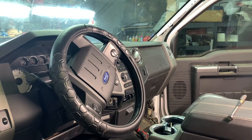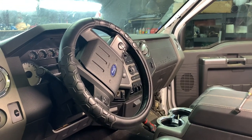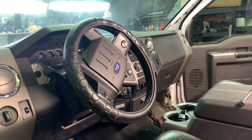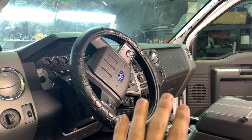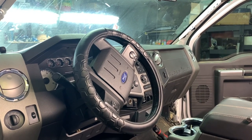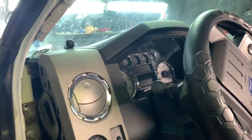It has an electric heater grid on the heater core down there to make the heat warm up faster — for the mall crawlers nowadays that have to have their heat warm as soon as they crank the truck up. For all us old-schoolers, we just crank our truck up for 10 minutes. Anyway, Ford wanted $400 and some odd dollars for that heater core, so our goal is to use the plain jane heater core option and hope it fits in the box.